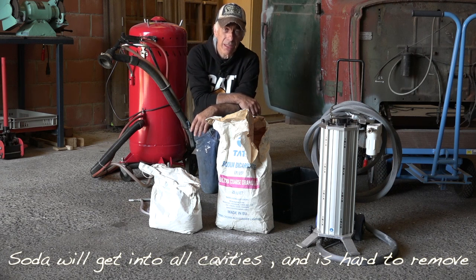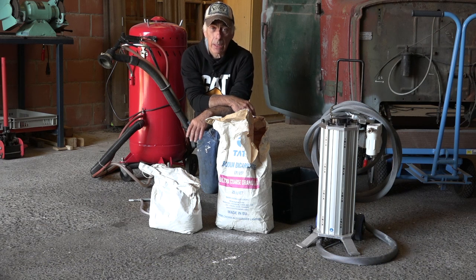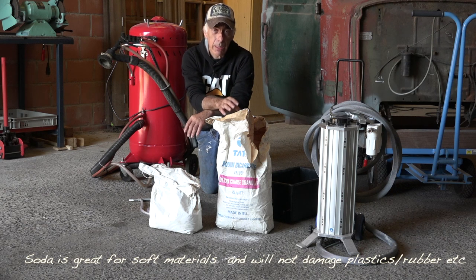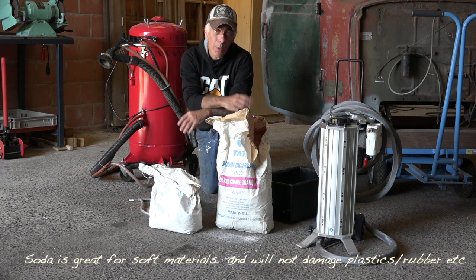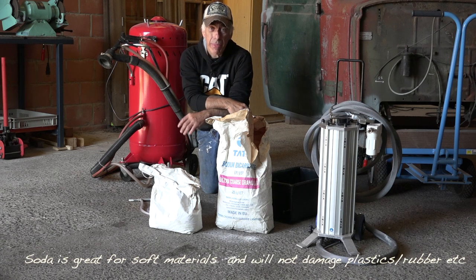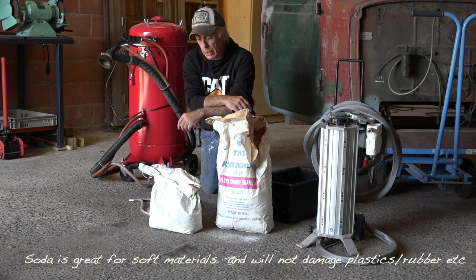Now, of course, if you have a very flat surface, you can use soda. If you can rinse it down very well, that doesn't matter. Now, the good thing about soda is it's great because it doesn't destroy any rubbers or plastics. You can blast on it, and I'm going to show you that later on in the video, on how good that is. It's great to clean up aluminum and engine blocks and all that, but I'm not going to use it for the body of the car. But even if you do so, you can use dry or wet soda blasting. And wet soda blasting is a mixture of compressed air, soda, and water, and that reduces the dust a lot. But we'll talk about this as well when we get further down in the video.